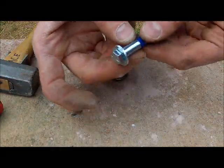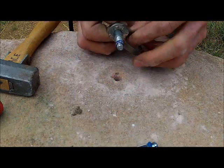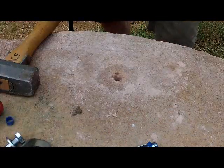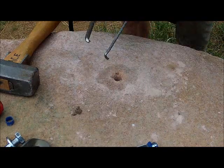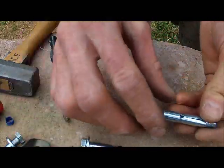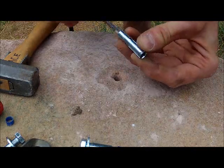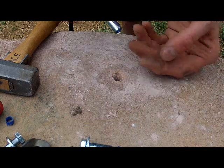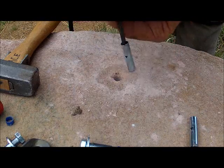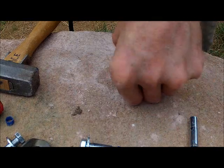These two sleeves at the front don't expand when the bolt is installed, so you can sometimes just pull them out like that. Those parts are out. This part down here is still in there — give me my hook tool. Two different versions of a hook tool. When you're trying to remove the sleeve, you can reach in and grab that little triangular space and pull it out. Easy — nice. Because this one's not rusted, we didn't have to do method number two.